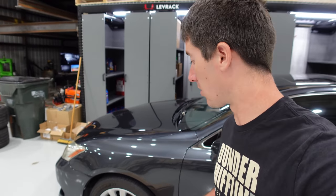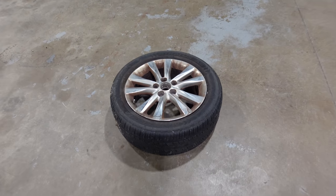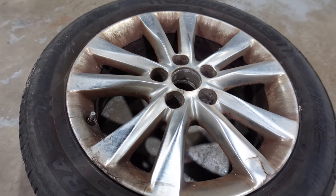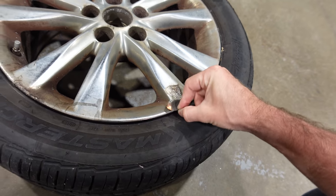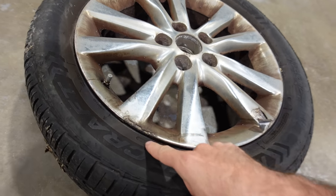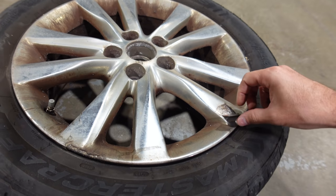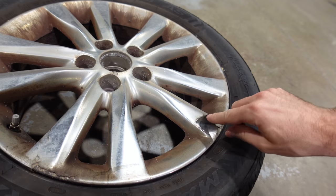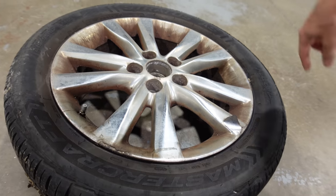The spares are painted. It would have cost a ton of money to switch the car to all spares, but the chrome had gotten so bad on this wheel that the air was just leaking out. It happens when the chrome completely fails. Once you get into this epic level of chrome failure where it's like peeling off the wheel, it gets in behind the bead and starts to fail there — and then it just leaks permanently. So this wheel is completely worthless and leaking around the bead because of the chrome.